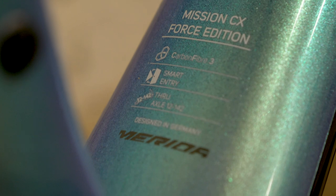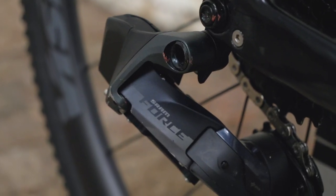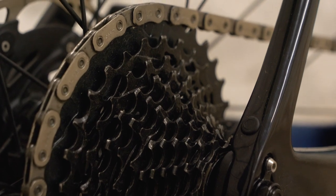It's got a Merida CF3 carbon frame. Their frames allegedly go from CF2 all the way up to CF5, but I couldn't find any CF5 bikes. So it's a good quality carbon frame with carbon fork. We've got thru-axles front and back. We've got a full SRAM Force AXS groupset — wireless, one by. So a 38 tooth chainring and a 10 to 33 at the back — race gears, but a decent range, probably not for really steep gravel climbs. 160mm rotors front and back, which I haven't really seen much before — that'll be good for larger riders.